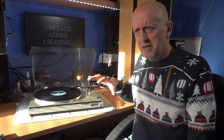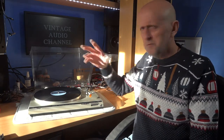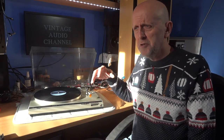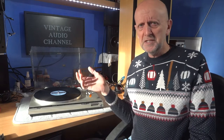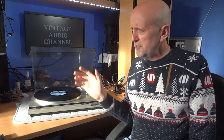With cartridges you've got a few to choose from: there's ceramic, moving magnet, and moving coil. I'm going to briefly talk about them — obviously go on the internet and delve in a bit more to find what suits your pocket and how you want to use the turntable. Starting with ceramic cartridges — these were used quite a long time ago on old-fashioned record players that used to play 78s. I'm just going to concentrate on 33 and 45 RPM records, which is the kind of turntable we're looking for. Ceramic cartridges are cheap — you can pick one up for about eight or nine pounds, and to replace the stylus is probably three or four pounds. They've got quite a high output, so you can probably plug straight into the auxiliary input of your amplifier.